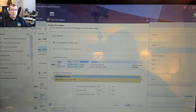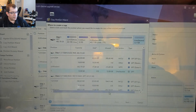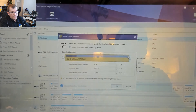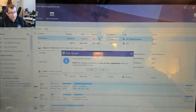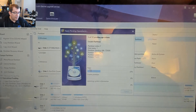It didn't leave enough room for the last partition on the drive, so I'm going to shrink this main partition a little bit. Then I'll manually copy this partition over to that unallocated space on here and slide it down to the end of the drive. Finally, I will resize the main partition to use up all of the available space. So now the two disk layouts look identical, with the main exception being that the big partition is half the size. I will apply this and then this machine will copy from the hard drive to the M.2 drive. I'll come back when this is done.